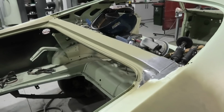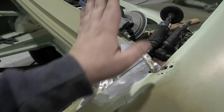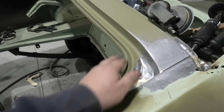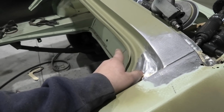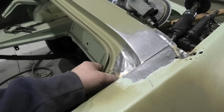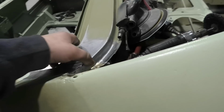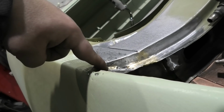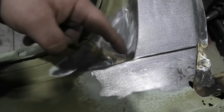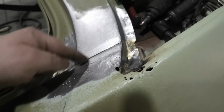I would strongly recommend you chase down the starting, because this is part 3, you chase down the reworked panel with the square edges. You don't necessarily have to go to the extreme I did with straightening up the edges. I'm just a little bit crazy, or brazing, and you don't really have to do that. I did that because I like to return things to factory. So the factory braze through here, that's actually some factory brass there, so I re-brazed it right through here, and it's spot welded and re-brazed through here, and then it's actually spot welded up and under here as well, so as you saw before.